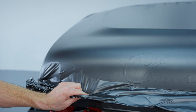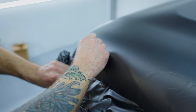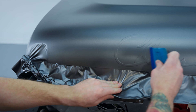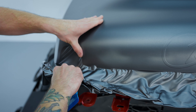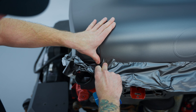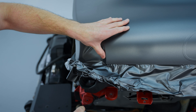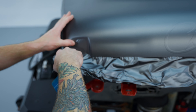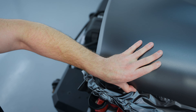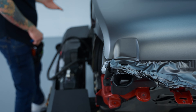So now when I pull the film the opposite direction of the wrinkles, they more or less just all go away. There's a little bit there but nothing yet. You see how this all just conforms right in there — it's just so beautiful. I can't even imagine it being any easier than this, unless it was just pressure sensitive, which you can make your own pressure sensitive film using tack reducer.